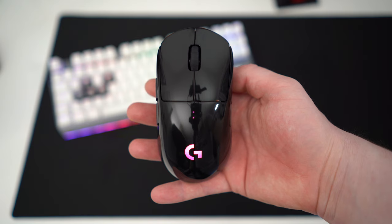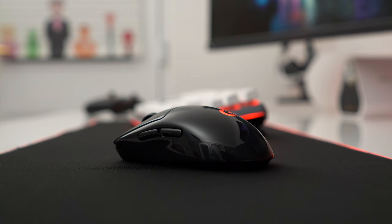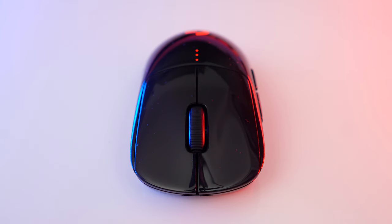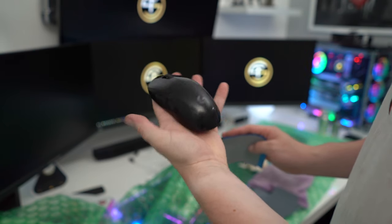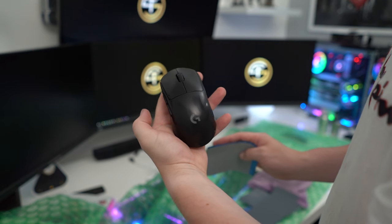From my testing, this glossy G Pro is far more durable. Plus, I'm able to polish it up like new whenever I want. The issue I had with gripping my G Pro Wireless has finally been fixed. Plus, unlike a glossy mouse that has a top layer of clear coat paint, my hand doesn't become slippy at all on the rare occasion it gets sweaty. I believe that's because a normal glossy mouse has a very smooth surface due to the lacquer. My method leaves tiny scratches from the wet and dry sandpaper all over the mouse, unseeable to the human eye. They provide a tiny bit more grip compared to a normal glossy mouse.